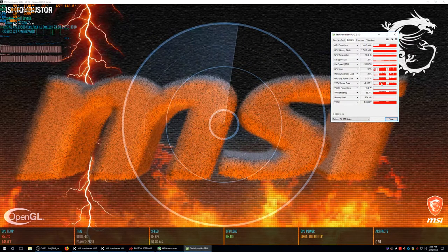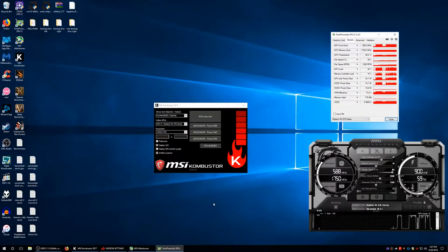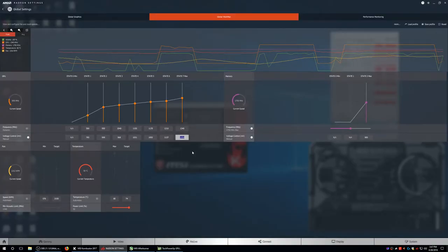We're at 1340 MHz and GPU-Z is telling me about 150 watts. No artifacts. Let's look at FPS too — when we undervolt we do lose like 2 or 3 frames, so right now I'm at like 65. From here I'm going to go another 50, then we'll go by 20s. At 1344 MHz I might not be able to go lower than 1000 mV.